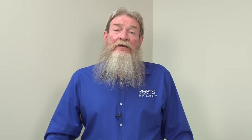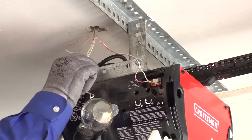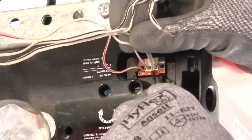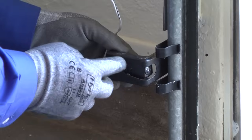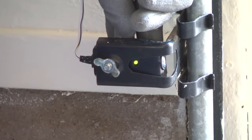Here's a link to some replacement wiring you can use to resolve the problem. Replace the existing safety sensor wires between the garage door opener motor unit and the garage door. Next, connect the new sensor wires to the motor unit terminals and the safety sensors. Reconnect the sensors to the door rail bracket and align them properly so both sensor lights turn on.